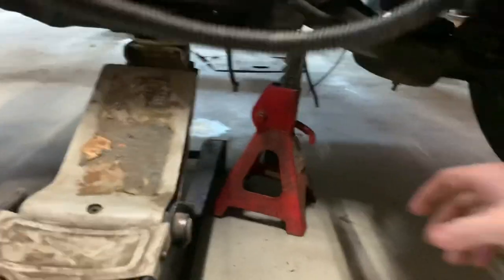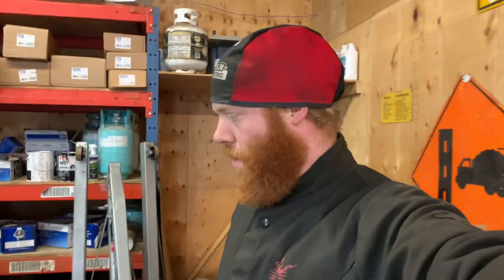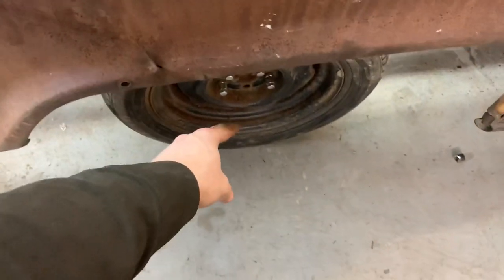I cannot wait to see what it's going to look like with the new tires and rims on it. I did a handful of tunes this week, and I ordered two rims. They're not beautiful, but they're like rock crushers. So they're absolutely not weld drag lights. They're like steel rims, 10 inches wide, 3 5/8 back space. So I think that's gonna give me like 6.5 inches out or something like that, which is a whole lot more out than these are.